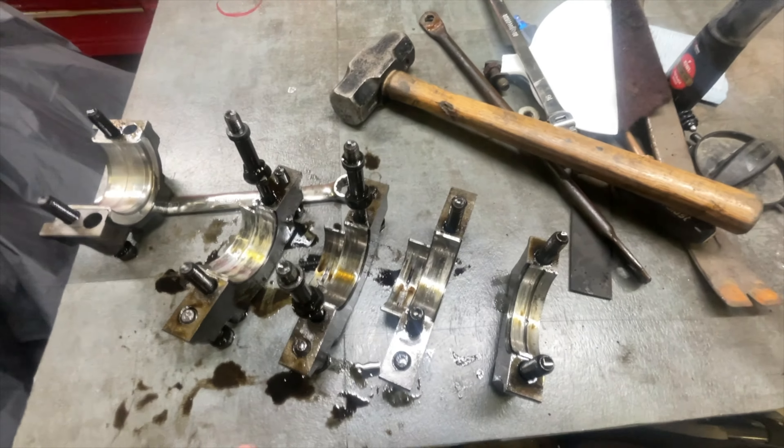That's what we're going to do - put it back together. I'm going to eliminate that oil line so this never happens again. We're going to run it and see how much longer I get out of it. I'll be willing to bet I get another good 50,000 miles out of this motor before it becomes an issue. The motor only had 120,000 miles on a 350 small block Chevy - that's nothing. This did do some damage, no doubt, and it did limit its life somewhat. But as long as no other bits got through - which I don't think they did - that screen caught it in the oil pan. I'm going to clean up that oil pump really good, clean the oil pan up, put a new set of main bearings in, some fresh oil, and we'll get it fired up and running again.